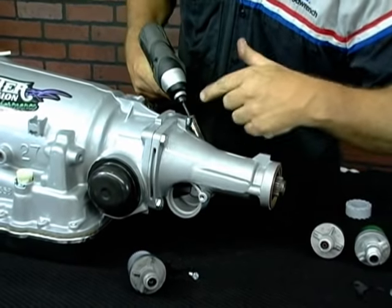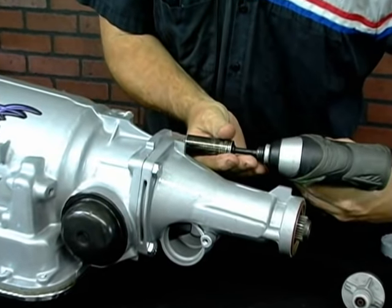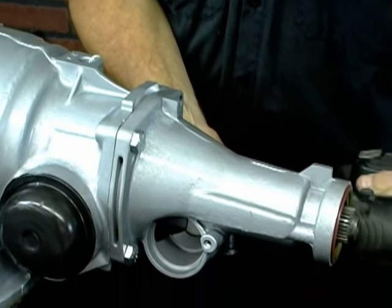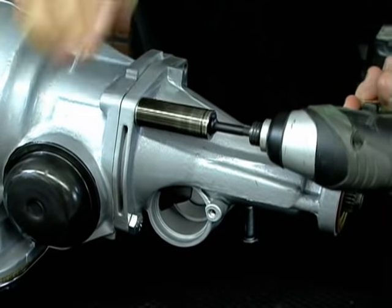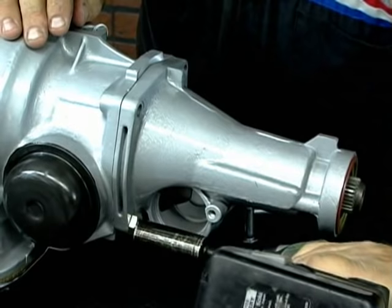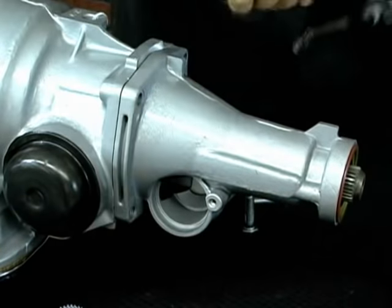There are basically four bolts — metric thread. Usually the heads on those bolts are 15mm. So you remove those four bolts. GM did offer a variety of different styles of tail housings, but the size and location of the speedo gear remain the same between the different setups.